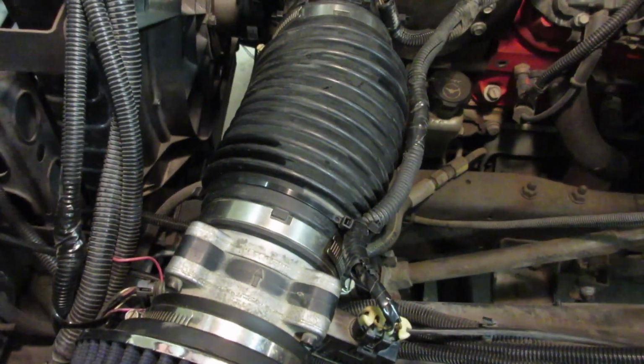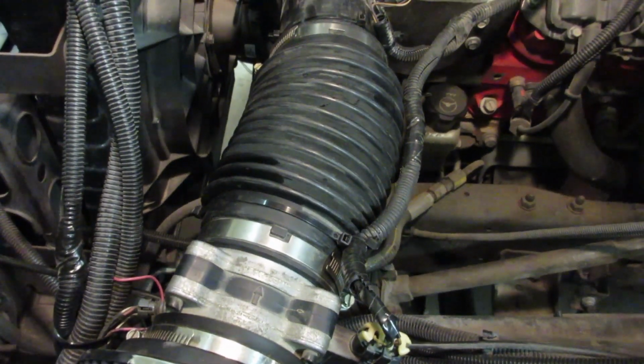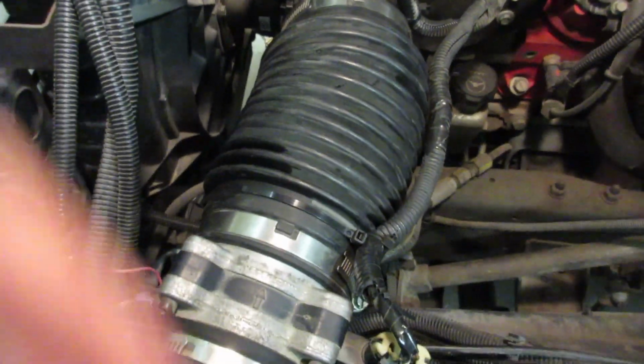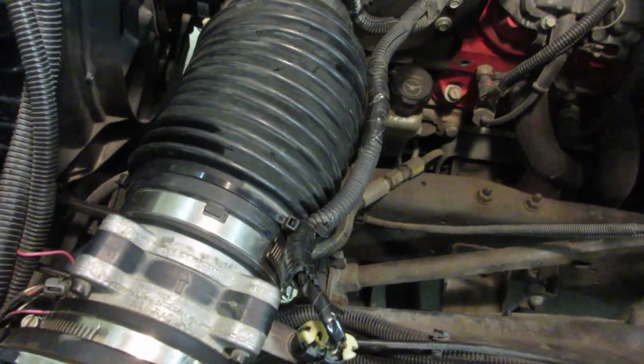You're trying to cruise 25, 30 down a dirt road, and you get that vibration and stuff just falls off. So on the K5, I built a bracket that bolted here and held it. I wanted to do something a little different on this. So I took this bracket and found a pretty good flat mounting location on the fender, and then it comes up and bends. You can see the bend there, and it goes up underneath the clamp, so you can see it's pretty tight.